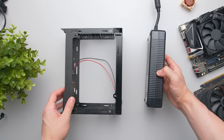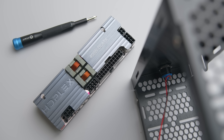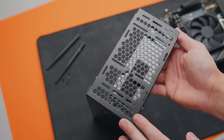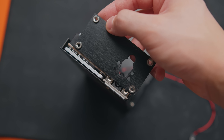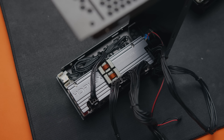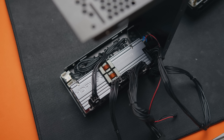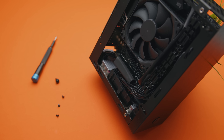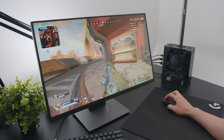The positive is that you won't need to bother with any fan swaps or fan noise at all, as both the power brick and the HDPlex 400 are passively cooled. I did have some installation issues in the Velka 3 — the mounting holes at the bottom of the case are supposedly meant to line right up, but they're blocked by the power button on the inside, and the included bracket for the plug doesn't line up properly either. So I used some strong double-sided tape for mounting instead, which worked surprisingly well. The HDPlex 400 is a fair bit smaller than the flex ATX unit, giving you more flexibility with cable management. You can route the cables somewhat sensibly and get the front panel on with no problem.